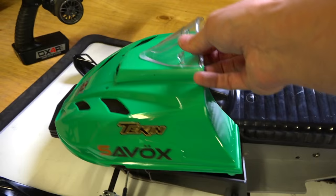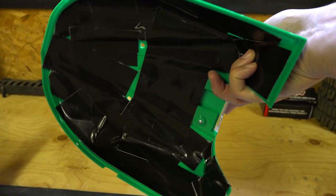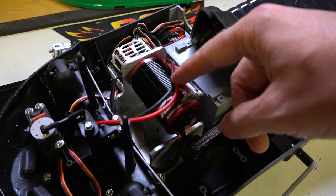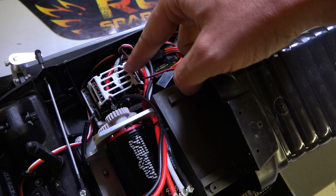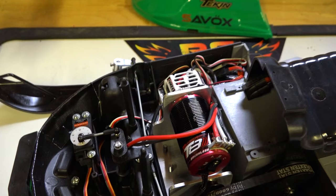This is the top, all assembled. I actually covered the slots — there used to be a nitro engine and there is a nitro version you can get — but I don't want snow going in all over my electrics. So the electrics are hooked up. This is a 1700kV brushless Tekin T8 motor. It is a sensored motor, so I've got the sensor cable running around the front down to the ESC, which is an RX-8 Gen 2. This Gen 2 I have somewhat waterproofed. I haven't gone the full way, but I did get in and seal up the holes for the suspension.